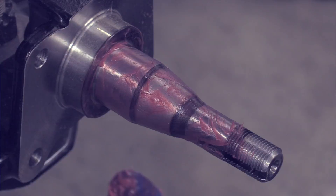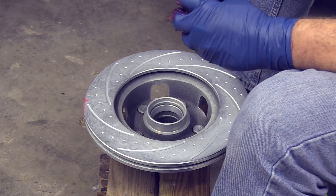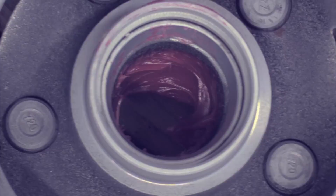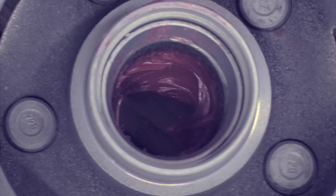Something I read in a Timken piece for big trucks: grease the inside of the dust cap that retains everything and keeps grease inside. Also, I'm going to put grease around the inside of the rotor — I've never done this before but Timken recommends it, so it's probably a good idea. It won't hurt anything, and it could help pick up any debris so it doesn't infect other areas. Fair warning: you are probably going to get grease on the rotor — use brake parts cleaner or lacquer thinner to clean it off.